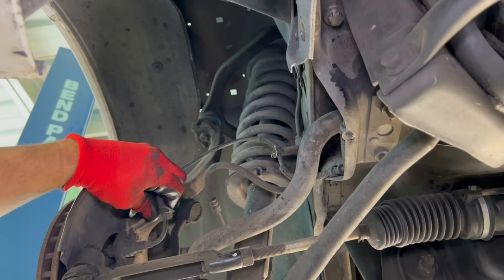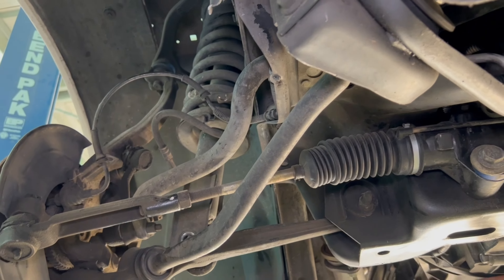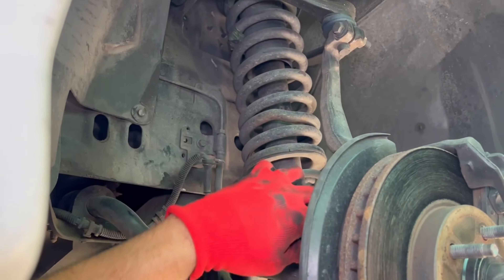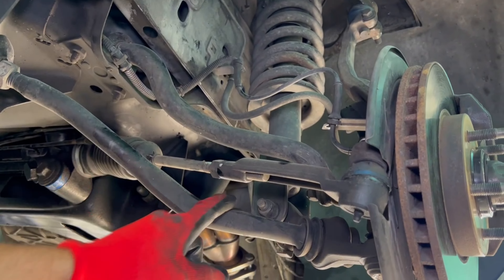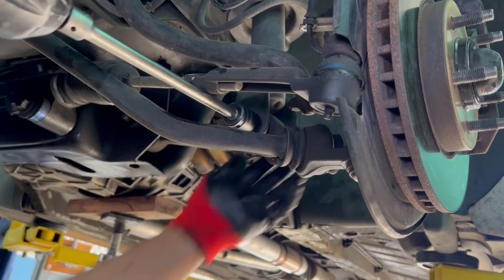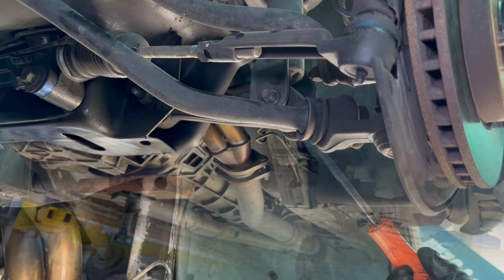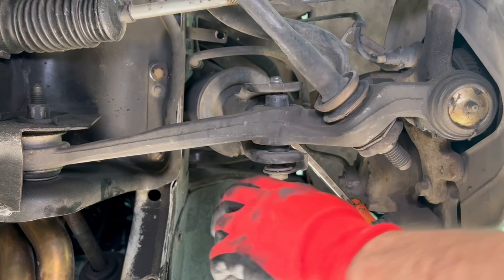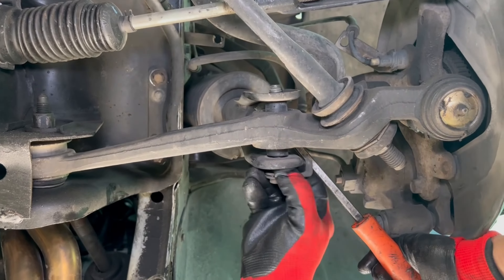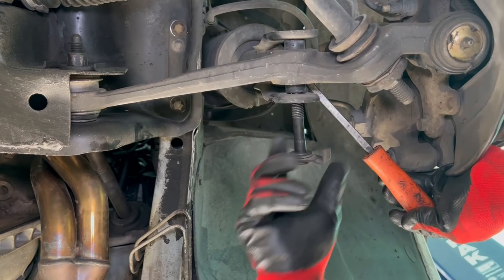This car has ABS — this is a great example. You need to come in here and just pry the ABS wire out of its little holder so it can hang. We'll do the same thing on the opposite side — you can do it by hand, you don't even need any tools. And we're going to move on to the shock bolt over here. Same thing, 21 millimeter — go under the tie rod end. Going to pry a little bit, put a little tension under the shock, and get that bolt off.